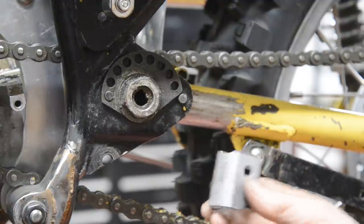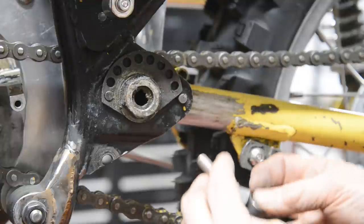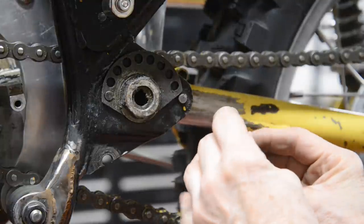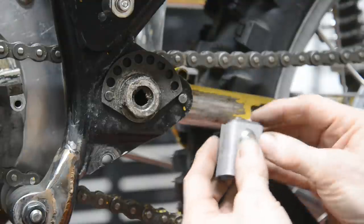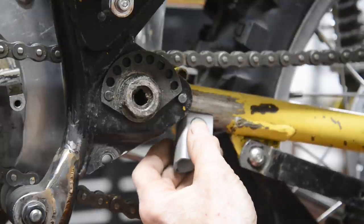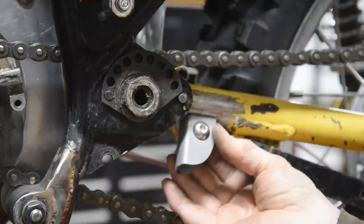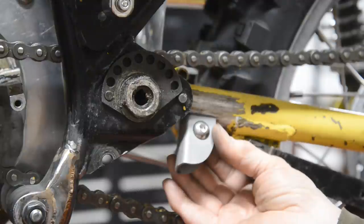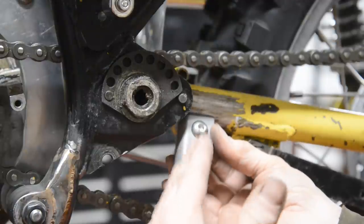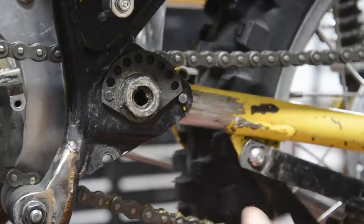Right then, I've slanted it a little bit, cut a bit out of the back. So we're going to just pop a bolt in, make sure I haven't taken too much off here so that this is touching that, which it's not. But now, as you can see, we have a little slant backwards. So with the extension of the leg, that's going to be well forward of this pivot point, so it's not going to be tending to fall, be pulled back by the spring.